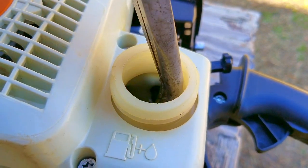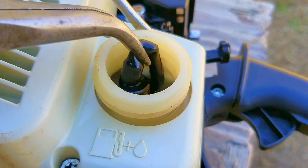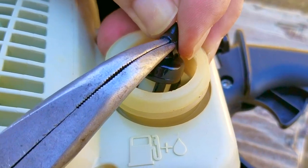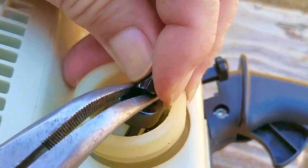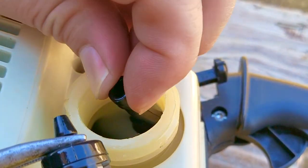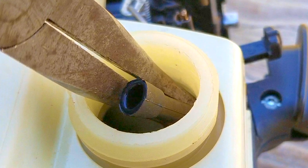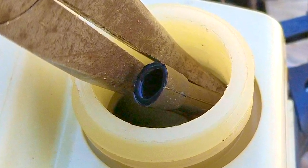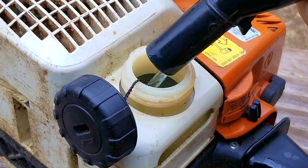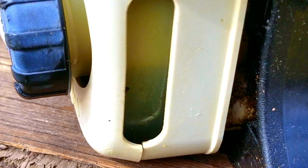While I have the tank open, I'm going to examine the fuel filter to see if there's an issue and confirm if it's the OEM or aftermarket one. Unfortunately, this molded fuel line is extremely short and shaped in such a way that I can't grab the head of the filter — I'm forced to grab it at the line. That means to get it out, I'll have to disconnect it from the line while it's still in the tank. This is when I realized something: the fuel line is extremely loose around the barb for the filter and may not be sealing like it should. Since I don't fill the tank all the way during testing — it's probably only about halfway full — this end of the fuel line might be out of the fuel and in the air. This wouldn't have been an issue if I filled the tank all the way, but doing it this way revealed we might have an air leak when the fuel level drops to a certain point. But wait — it gets even worse.